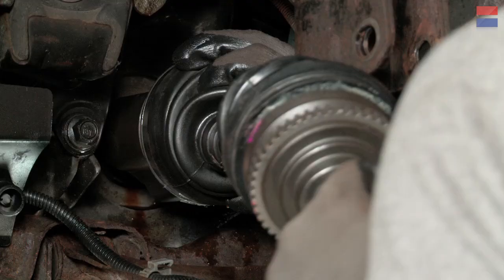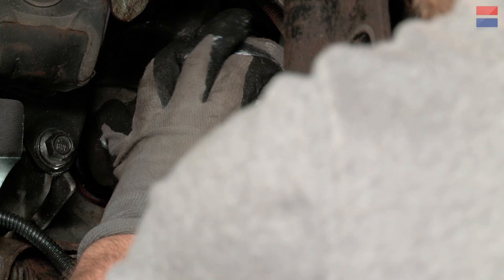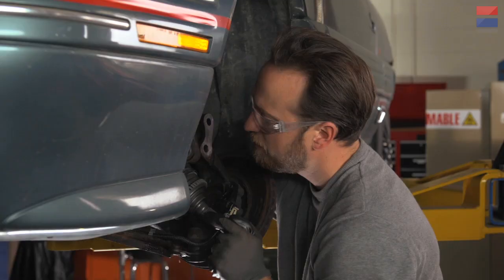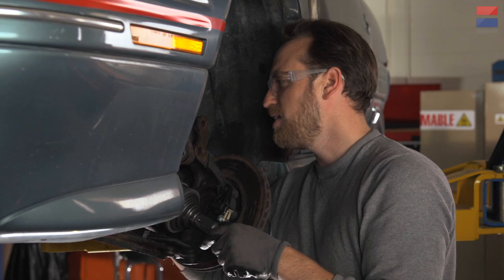So here's our new axle. You need to make sure to clean everything in this area before you put it in so you get a good sealing surface. This edge of this surface is the primary sealing surface in that seal, so you'll want to lay down a bit of white lithium grease on the edge so that sealing surface is in tip top shape. With that, we're going to put this in. The trick is to align it and then press it into place. You can hear it seat just like that — it's against the transmission case and seated on that circlip.